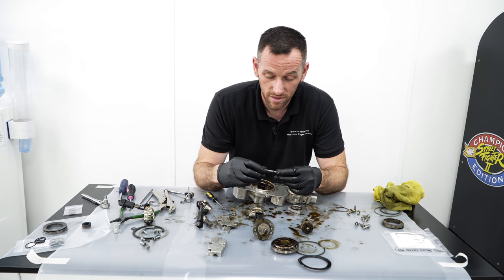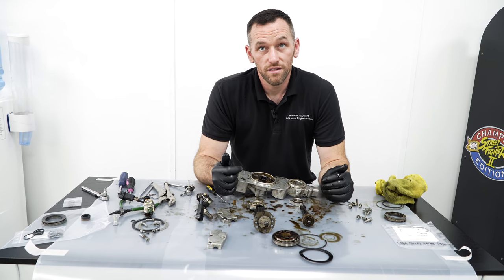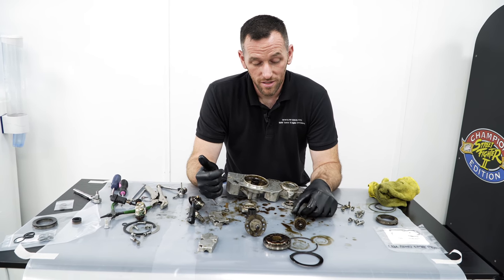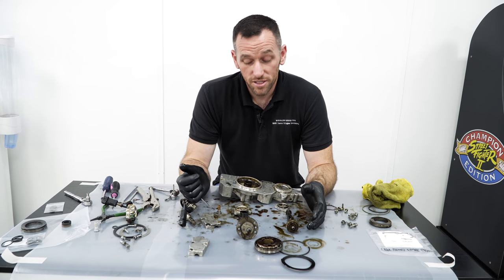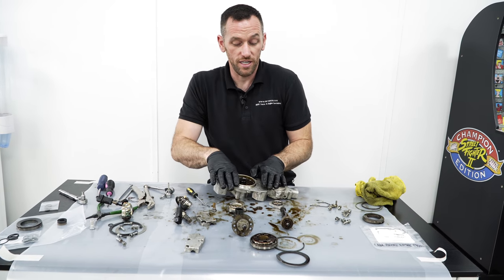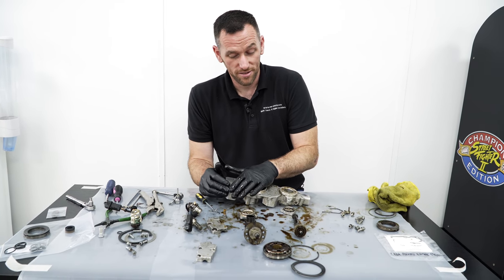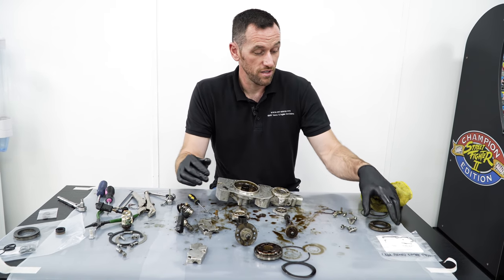Yeah, because I think the only issue I really had, as people who follow the channel know, the car made good power. So I think the VANOS was actuating correctly. It was just a noisy rattle, which is one of the things that you get. And then that's a spring washer, you said? There's two parts to the unit. So you've got the noise, which comes from, if you take this off the car, the other part on the head, which creates the noise. The function comes from the unit itself, and a running issue, lack of power or lumpy tick over comes from what we've got here.